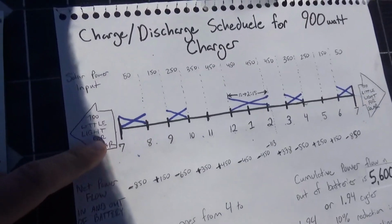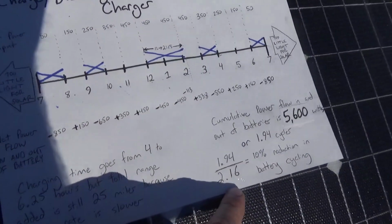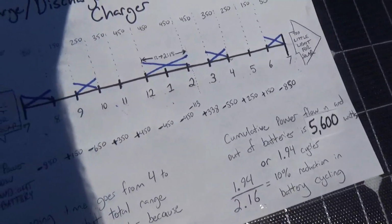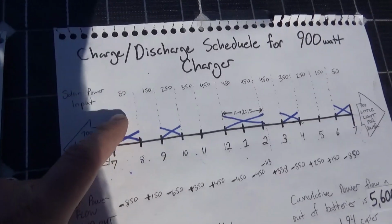So while there are some limitations by what we can achieve using variable rate chargers, there's plenty of room for significantly reducing the cycling we're doing to our batteries by trying to get our charging amperage to match our solar input.